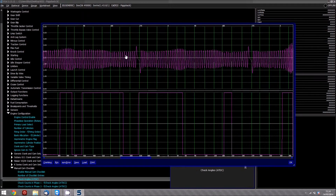Now, the important aspect here is obviously when you have gained ignition timing to be correct and crank reference has been input correctly on the Syvecs ECU, so you've got the engine running in 360 mode. Enabling the 720 requires you to study this next graph. So you've got the camshaft teeth being shown on here, but at the present time you haven't got any setup in for the camshaft in terms of whether you're triggering on the rising edge, the falling edge, etc.